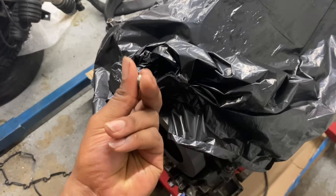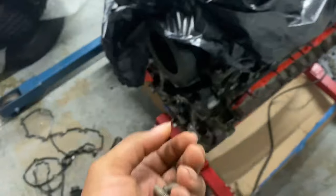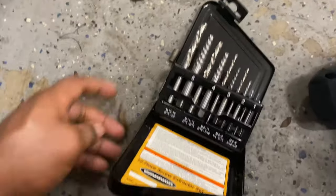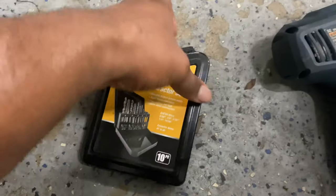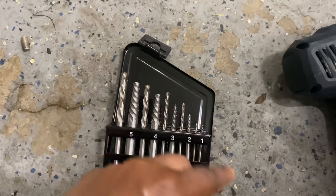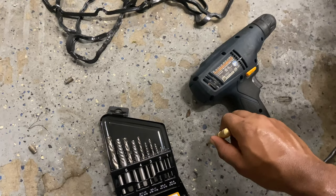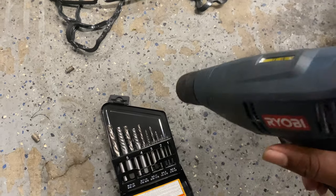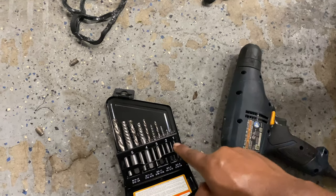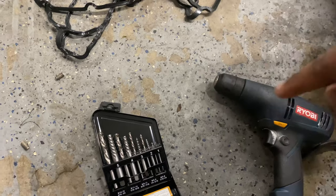One of the three still had a head attached so I could just use pliers and twist it out. For the rest I had to get a bolt screw extractor kit from Harbor Freight. I used number one in the kit - what you do is get a punch and punch a hole in the center of the screw, then put the drill bit on your drill and go counterclockwise to get a hole indentation a little bit deeper, then use the extractor bolt the same way in reverse and everything just spins right out.